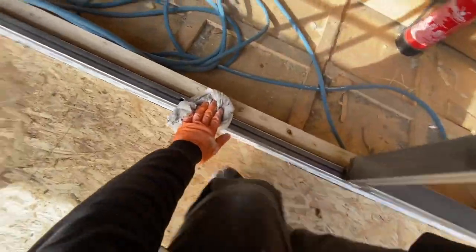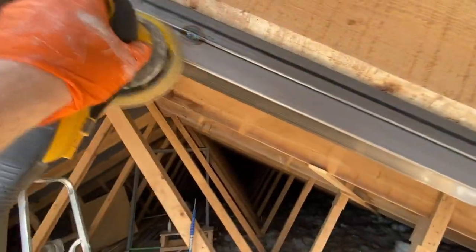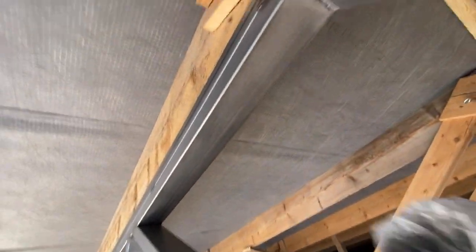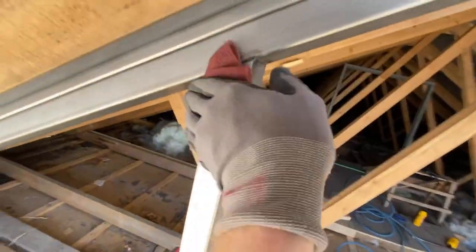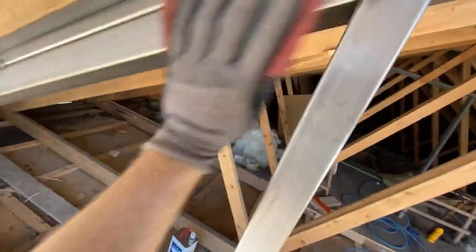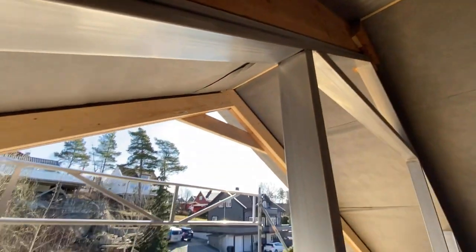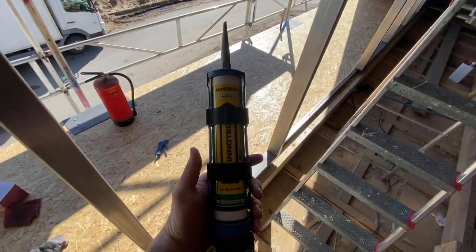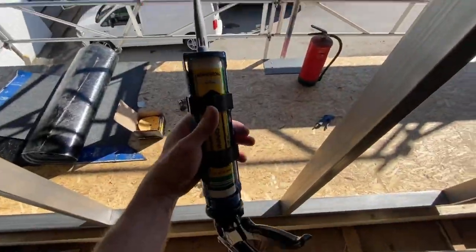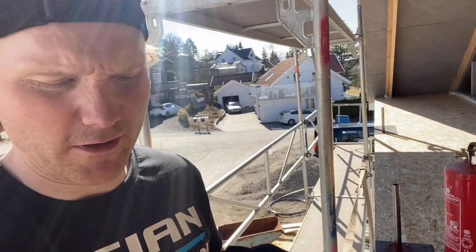Sun has finally arrived. Now I'm cleaning this frame, then I'm going to start to sand it with 240 paper — just to get a little bit of scratching. After sanding I'm cleaning it a second time with silicone remover. Using a file on the edges and in the cracks where I can't reach with the machine. When this is done, I'm putting a few beads of sealant — I'm using Enotec Adesil, the same I use on Chrysler cars. Sealant is done between the metals. Now this is going to dry while I eat, and when I come back I'm going to put the primer on.